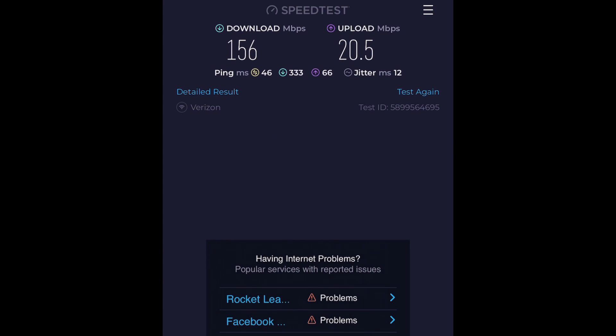Let's summarize our findings. It's not a bust — I was pretty impressed with some of the speeds we got. However, as you noticed in the video, they obviously got slower. That's generally how Wi-Fi works — the farther you are away from your original Wi-Fi source, the slower your speeds are. That's the same with access points too. But where this thing lacks is the backhaul. Because it's just a dual-band device, it's using the same antennas that your devices connect to in order to communicate back to its buddy, and therefore it's sacrificing some of the speed.